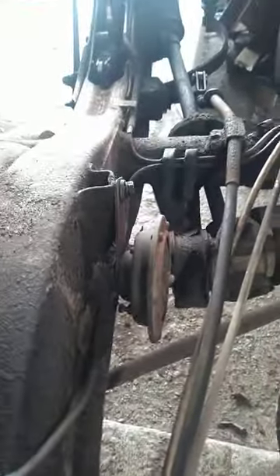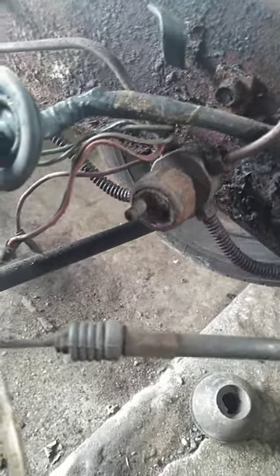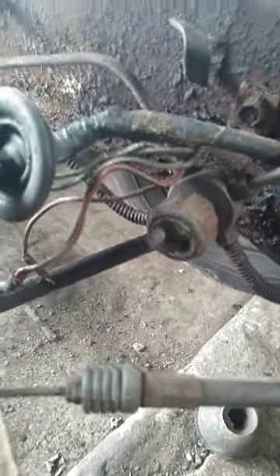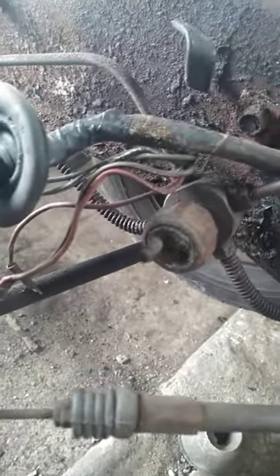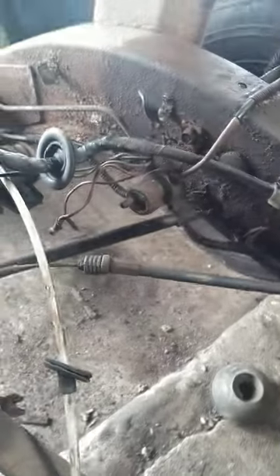Location of the two-terminal horn right here — it's actually supposed to be at this angle, it's already half off. We have a pretty standard looking brake switch here, which is broken and only shows one terminal, but that's basically a normally open standard brake switch you can get at Napa or anywhere.